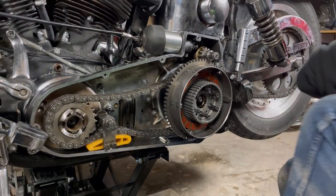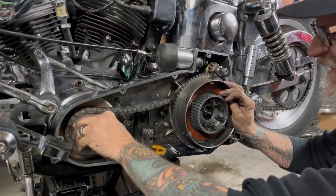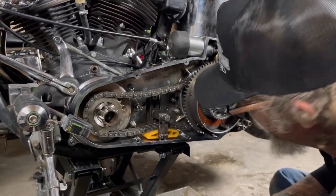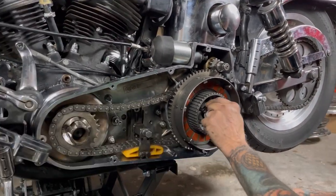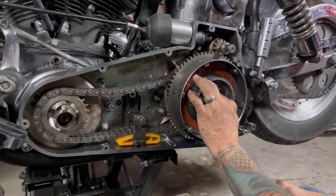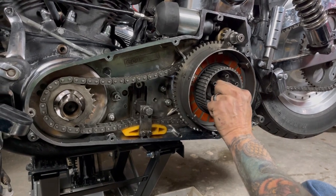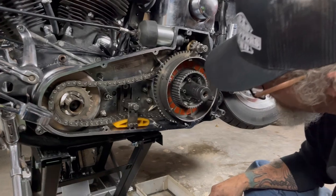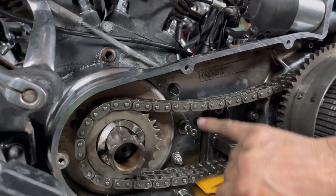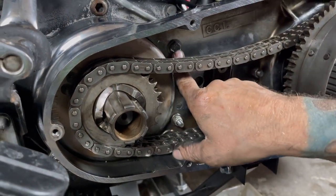Let me get down on the floor where I can see, since I don't have my big lift available. She is in like Flynn. This is one of these Scorpion clutch packs. Unfortunately, there's no way to put a lock tab - usually these have one of those washers where you bend the tab over. And if you notice, this is left-handed, so turning it lefty-loosey is actually to tighten it. See my safety chain back there? That's why you have to have that - so a big nut like this won't rub against the chain, and that way it can never back out because it's tethered.